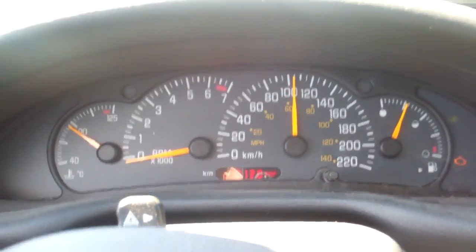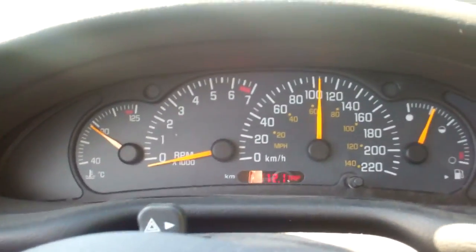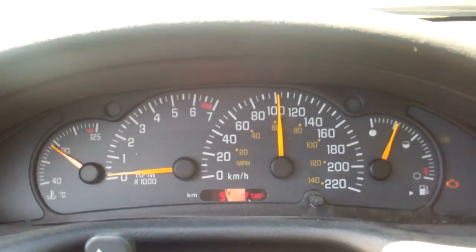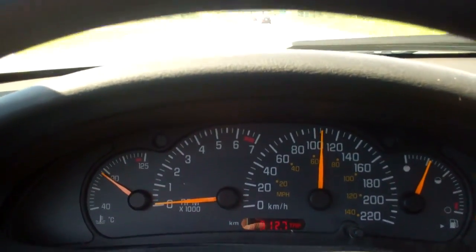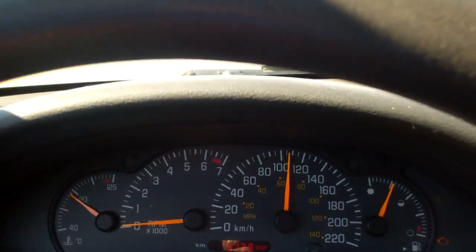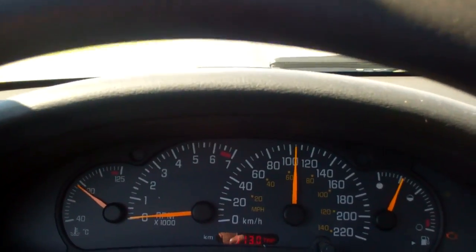Okay, we're going to turn right out on the highway here. Turn right again. I'm hoping that whirring noise is coming through, and I can actually even feel, with my foot on the accelerator, a vibration increasing as I turn right, putting the weight of the vehicle, as we discussed, on the left side of the vehicle on that bad bearing.